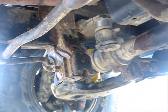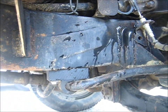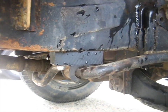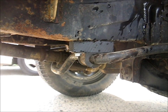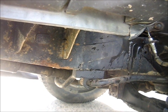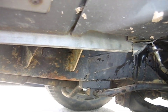Now we're outside in the hot and humid weather. You can see the spacers installed there — both differential drop spacers — and both sway bar spacers as well. You can see the water dripping from my working air conditioning evaporator. I did have to re-drill the holes in the Delrin bushings as they were slightly too far apart, but a Dremel made quick work of that. Overall it's a fairly simple process. I'm going to send FourCrawler an email and let them know the hole spacing was a little bit off so hopefully future purchasers won't have this issue.